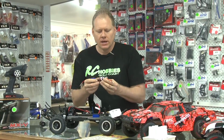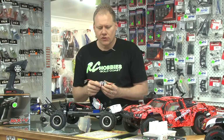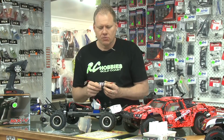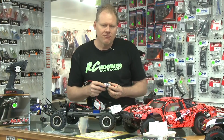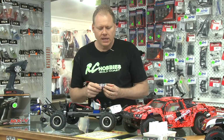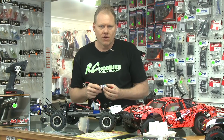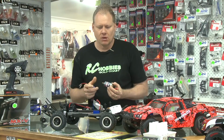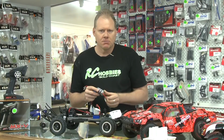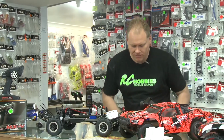Years and years ago, the easiest way I could say it is, if you went back 35 years in time, batteries for remote control cars used to be nickel cadmiums. A good nickel cadmium battery would have been around maybe 400 to 500 to 600 milliamps back in the day. If you were lucky, that battery may have run for, say, 4 to 5 minutes tops. That would be the maximum runtime. I'm being honest, probably 4 minutes. And they never really had a problem with burning the motors out. So that's our brushed motor setup we do away with.